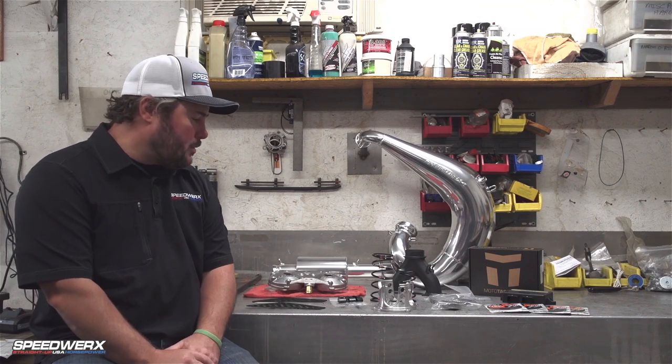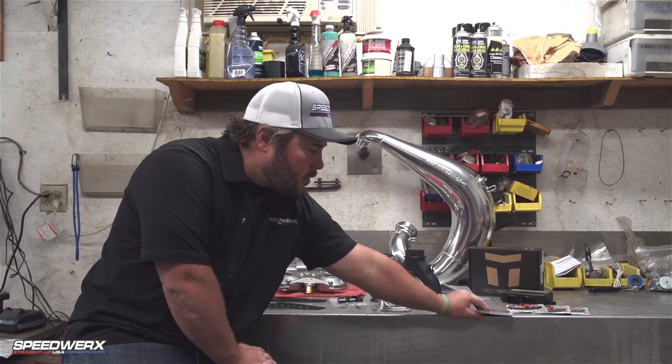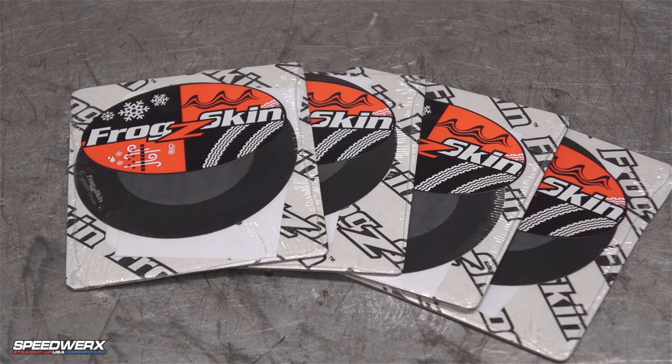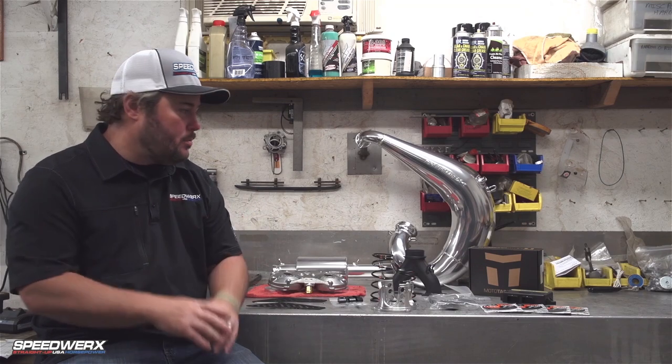It's just a little thing that helps add a little bit of everything. On the intake side of things, we run frog skins throughout the air box on these models — that's a very important setup. Again, we're getting more air and we're getting cold air in there, which is helping us build more power.